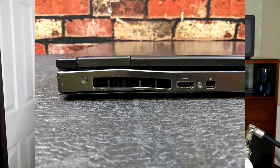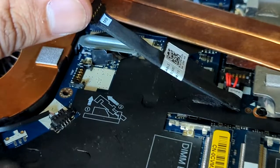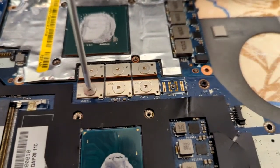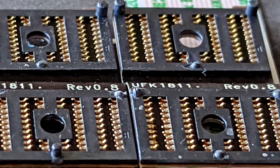In the end, what had happened was — I'm assuming this thing got dropped or kicked — but for some strange reason, inside, it's not an MXM GPU. The connector type isn't MXM. It has a little cable on one side, but there are three Dell DGFF connectors. Of the three, two of them looked like they were damaged.